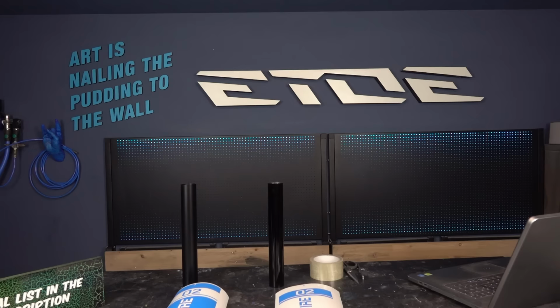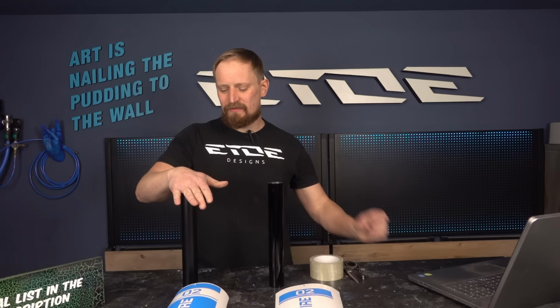Back from the paint booth, or in your case, your garden or your garage. And now it's time for the matte and gloss combination. What I'd like to show you is the most simple solution, spraying directly with a matte clear coat, and the more advanced solution with a better quality, applying a sticker, doing some sanding and some preparation, and spraying matte clear coat on a gloss one.